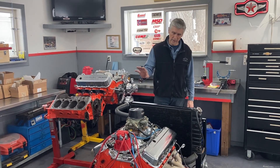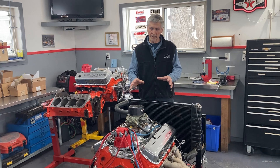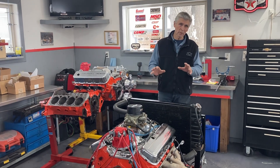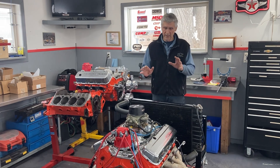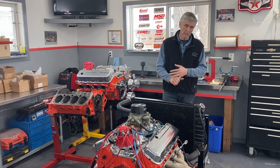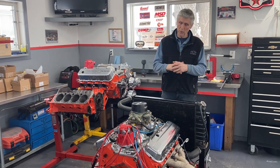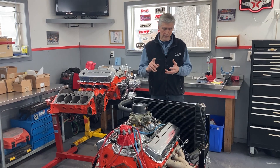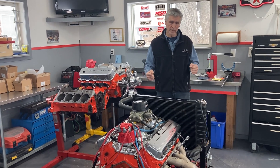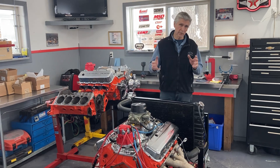I'm not going to replicate all that in this video. When we started with this engine, back at my customer's shop, he had bought a project car — another '66, by coincidence. This engine was in it, and all we really knew about it was that it was a big block. The engine came with the car, so it was kind of a mystery engine. We needed to know exactly what size big block it was, whether we could start and run it or not. I went to his shop with the endoscope camera, put the camera in the intake manifold, saw there was a flat tappet cam, put the camera in the cylinders, saw the condition of that, and confirmed there was a flat tappet camshaft. I put a dial indicator on the camshaft, so it was kind of obvious what the cam was.